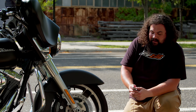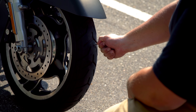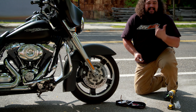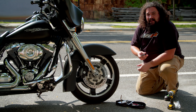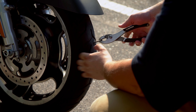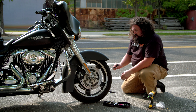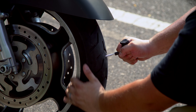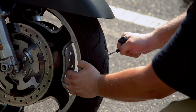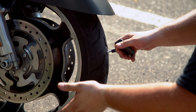Pliers don't come in most tire repair kits, and that's really unfortunate, because once you've got something inside your tire it can be almost impossible to get out with just your fingers. You'll find that's true of most things that embed themselves in a tire. If your tire repair kit doesn't have a set of pliers, think heavily about adding them. Now, working quickly, we're going to get this screw out, then ream the hole — use these knurls to cut in there and make sure all the fabric or steel is nice and smooth. Now this thing is ready to accept the plug.